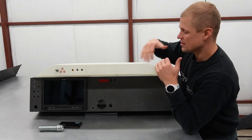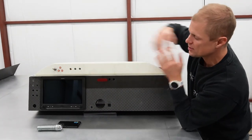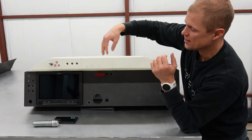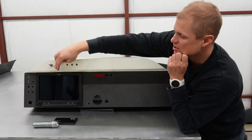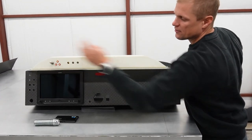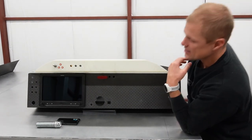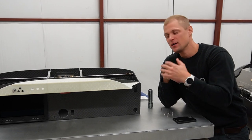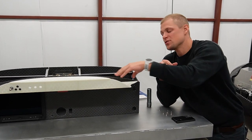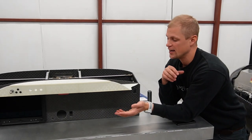Another benefit of this structure is it adds stiffness to the instrument panel where cutting the big holes for the displays makes some sections a bit thin. It also adds extra real estate on the panel for switches — the glare shield displaced where we had the switches before, so now we're able to move them up here: the landing gear switch, the gear position lights, and lights for landing, strobe, and nav. One customer suggested you could install lights on the bottom of the glare shield to act as a map light. Interestingly, this fiberglass is translucent to light, so you can just put lights on the back side and it'll shine through — the fiberglass does a nice job of diffusing that light.